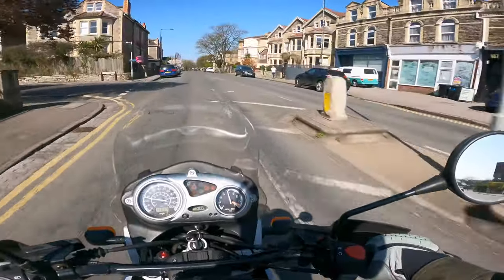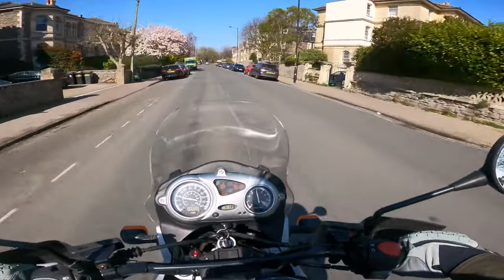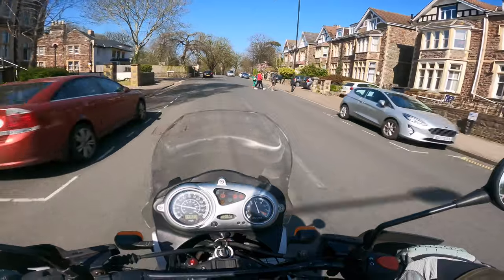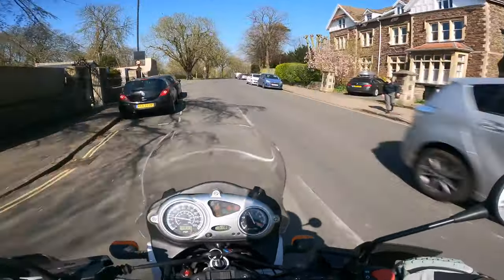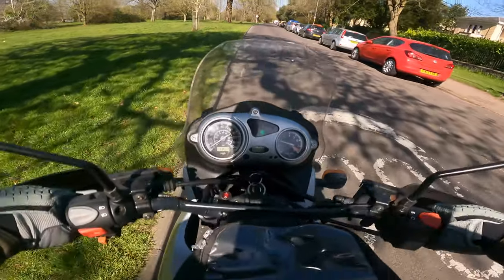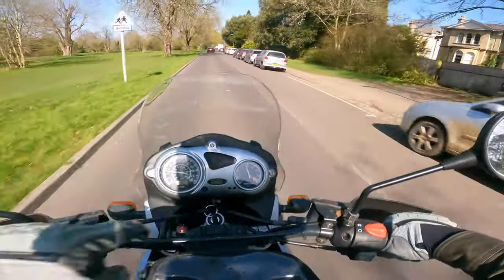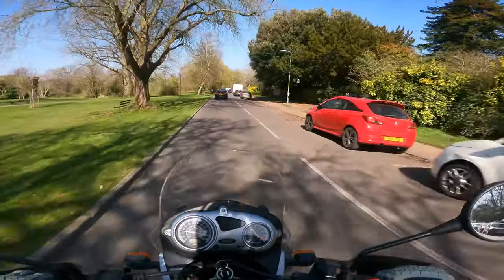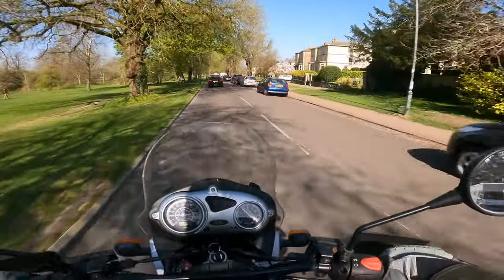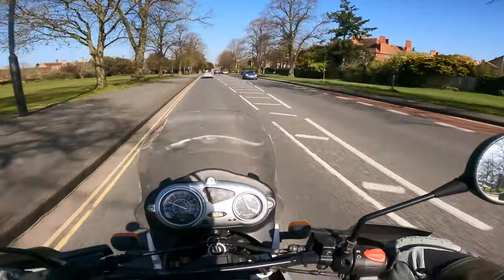I don't know if they'll let me film, so I'll just take the helmet camera if nothing else. There's some rattling I need to sort — I've taken the left floodlight off to repair it. Turns out the engineer who put it together neglected to crimp the wires, so it's lacking a good electrical connection. I'm meant to be there at 12 o'clock and it's quarter to now, so I need to get a shift on. This bike has no problem with torque — it's got a good amount across most of the rev range.